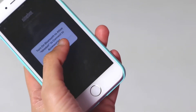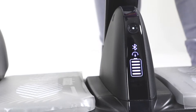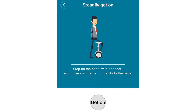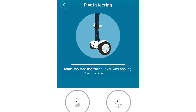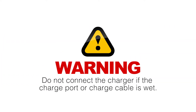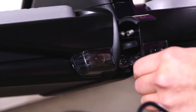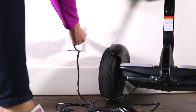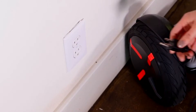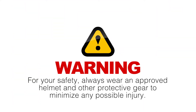There are safety risks when learning to ride the Mini Pro. You must read the Quick Start Guide and follow the new rider tutorial in the app before your first ride. Scan the QR code in your Quick Start Guide to access the Ninebot by Segway app. Once you've successfully installed the app, register and log in. Power on the Mini Pro by pressing the On/Off button. The Bluetooth icon blinking indicates the Mini Pro is waiting for a connection. Click the Search Device button to connect; the Mini Pro will beep when successful. You must complete the new rider tutorial, which details proper riding techniques so that you may learn how to ride safely.